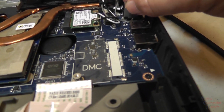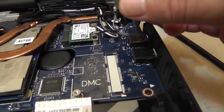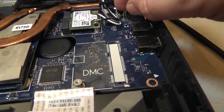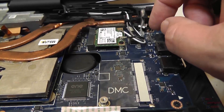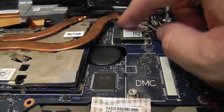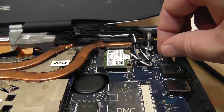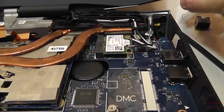Here's the network NIC that was soldered to the board — that's what's left of it. You can see a couple of the pins still stuck to the board. Perhaps that's shorting, or perhaps it's already shorted. These just need to come off — I'll snip those off. And here's the wireless card I was looking for. Pretty bad. All those pins were touching each other so that may have been causing some shorting problems.